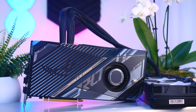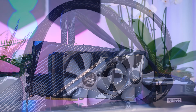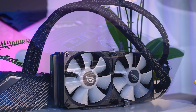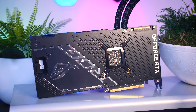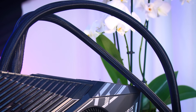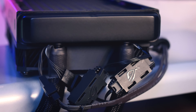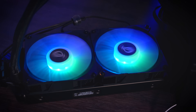Let's take a look at this ROG card. It is a pretty chunky card. The main unit that holds a single blower-style fan is almost 30 centimeters long and about three slots thick, and it also has a 240 millimeter radiator connected to it. The build quality seems excellent with a really well-made backplate and what looks like an AIO pump-radiator setup. The design choice to separate this radiator has its upsides and downsides — your case needs to have a spot for the 240 millimeter radiator and you do have to route these tubes somewhere. Fan and RGB cables aren't much of an issue as they're already connected to the GPU.